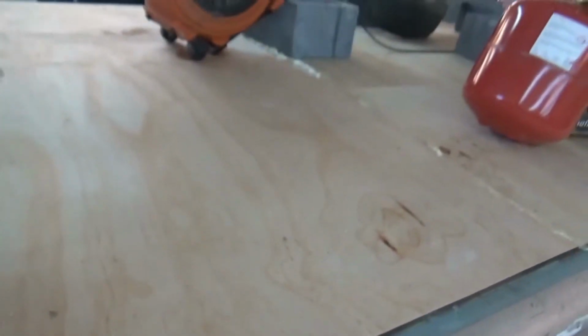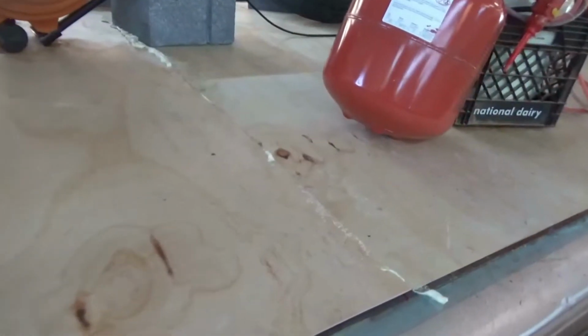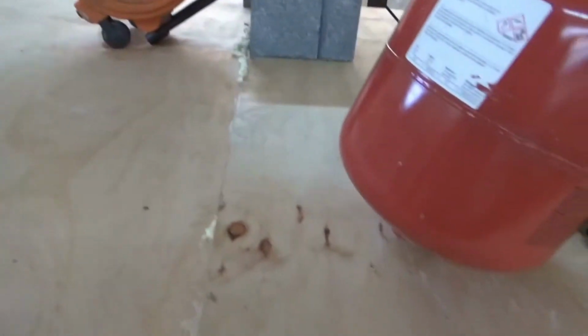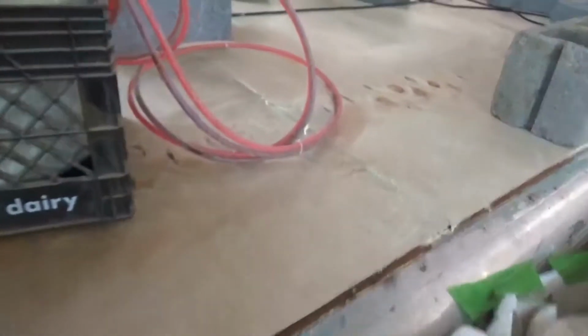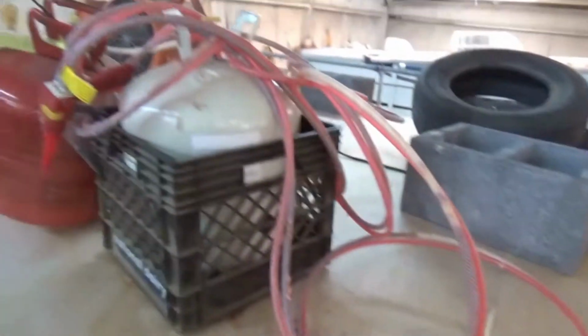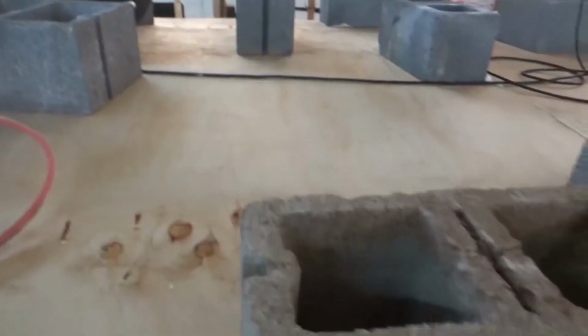These are Fleetwood Providence updates. So we are laminating a new roof deck down. The old roof had that fleece under it, and that fleece, if we had tried to glue to it, would not work because it would ball up. So we glued down a new roof. We used some good, expensive adhesive to hold this stuff down.